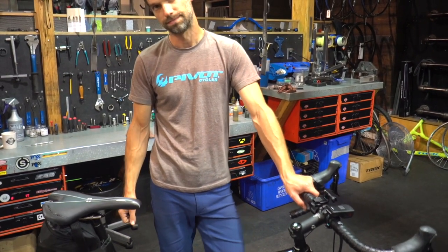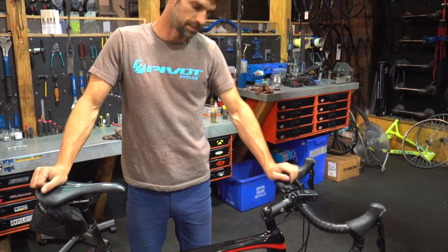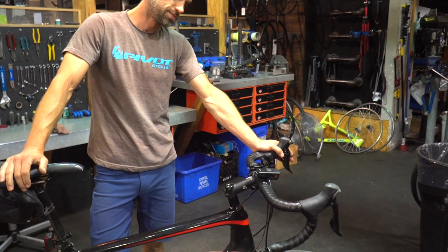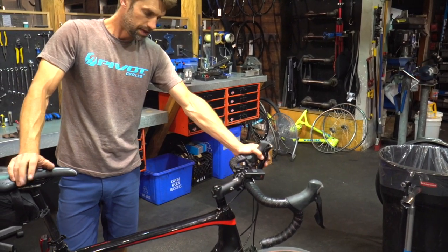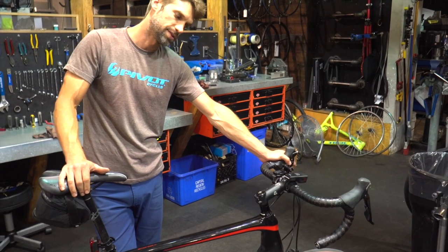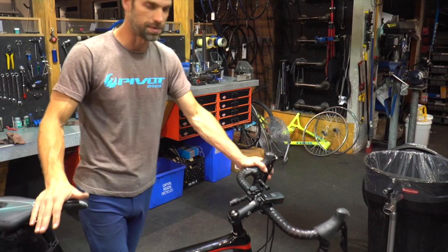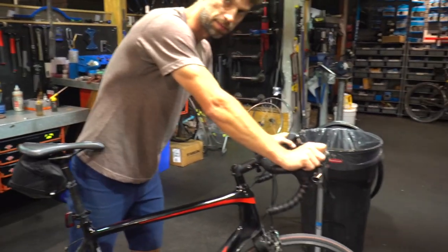When riding in really wet terrain, it can be incredibly hard to brake — it just slides in a way. That's just rim brakes on road bikes in the wet. You can improve it a small amount with different brake pad compounds, but the big thing in the wet is just to realize your stopping distances are 20-30% longer. If you have a newer bike with hydraulic disc brakes, those stopping distances aren't nearly as bad — they work amazingly in the wet. But with rim brakes, you just have to be aware it's going to take that much longer to stop.